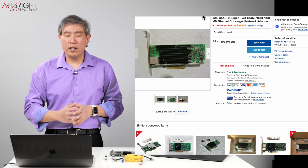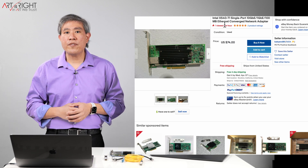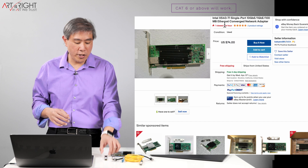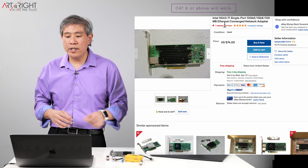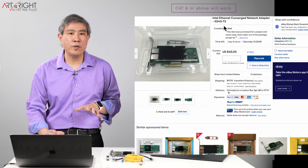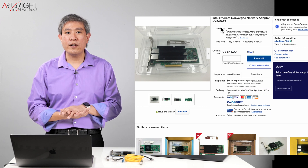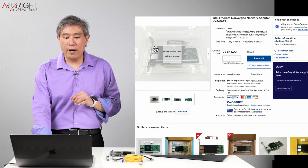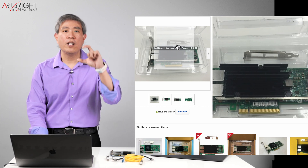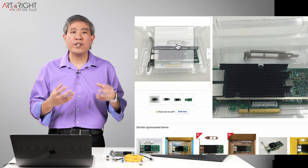A few other things to look for beyond getting a genuine Intel card: consider how many Ethernet ports you want. The Intel X540 uses a standard RJ45 copper connection, so you can run it with standard Cat6 cable without any issues — you don't need SFP+ modules. There's an X540-T1 with one port and an X540-T2 with two ports. Also, check whether your Synology requires a low profile card. Many of these cards ship with a full bracket, so look for one that already comes with a low profile bracket so it fits without having to source one separately.